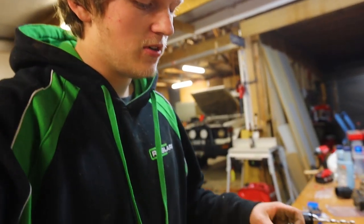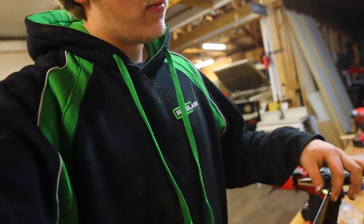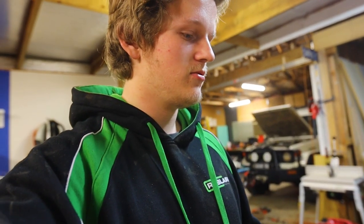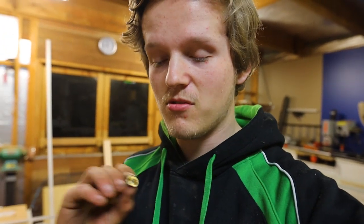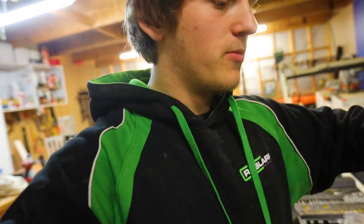In the future when there is a battery here, it might be a bit difficult to get to if we ever need to take this off to change the filter or something like that. I don't really feel like pulling the battery out every time, so I just undo it and it'll come straight out. Seriously, if you don't know what nutserts are, just grab them — you never know when you need them. If you need to bolt something where you can't reach the other side, like to the floor of your car, just chuck the nutsert in to the bottom of the floor and it bolts straight to it. It's great.